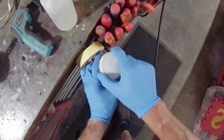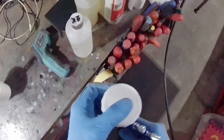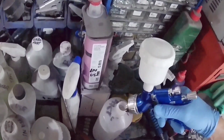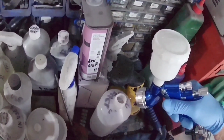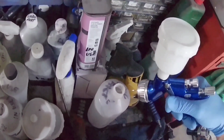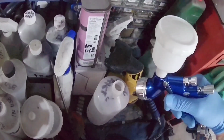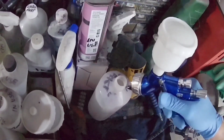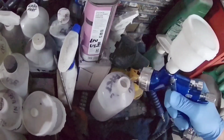But the idea of doing this video was that I got a Sata 1.3 CC, and I'll try and remember to put a link in the description. I did a couple of videos with it, and it is a very, very good gun and lays clear coat very, very flat. The T110 is also capable of giving a really flat finish to clear coat, although I use it with the 1.2.